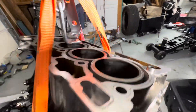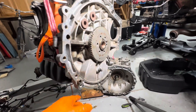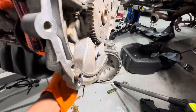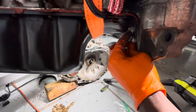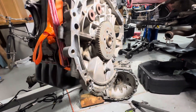You could hit that position, by the way, and still not be aligned here, so you may have to turn that over one more time to actually get to that position. You can do this with your cylinder head cover on — you just have to keep feeling in there until this drops in. It's not going to drop in by itself; you're going to have to put pressure on it, very light pressure, while it's turning around until you feel it kind of drop in like so.